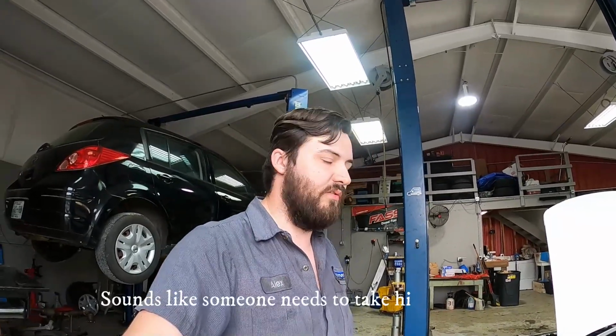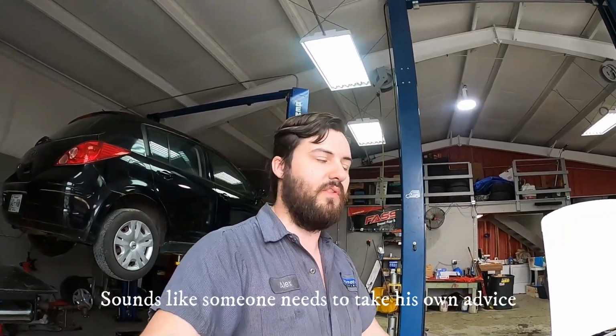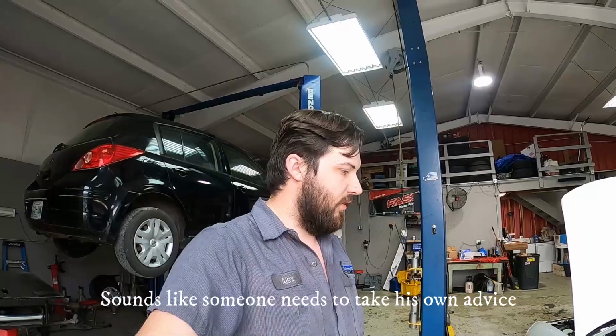If you check for power on your ignition wire, the black yellow wire, and you don't have 12 volts, go to your fuse next. Make sure your fuse isn't blown. Make sure you have 12 volts at your fuse. So yeah, hopefully that helps some people out with diagnosing their alternator on their Integra.